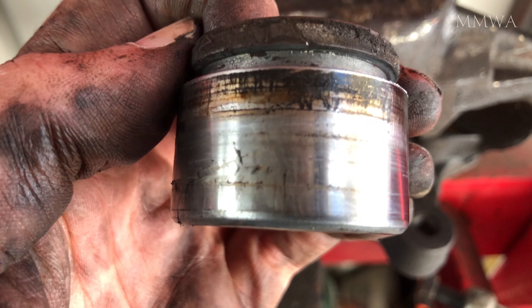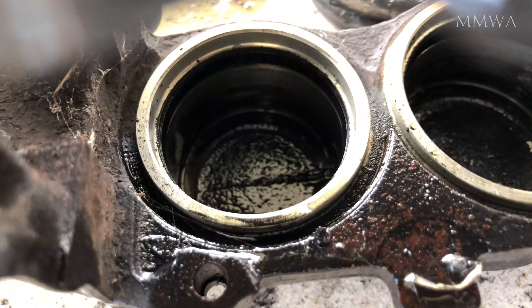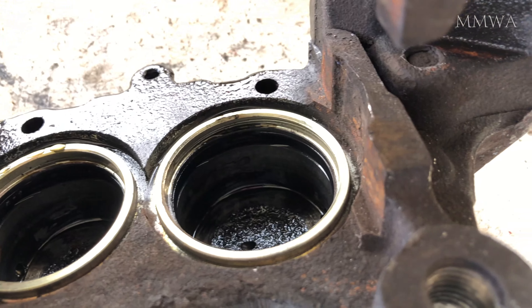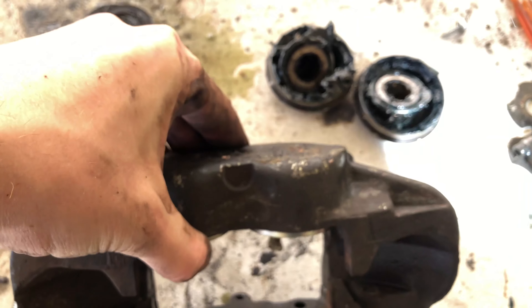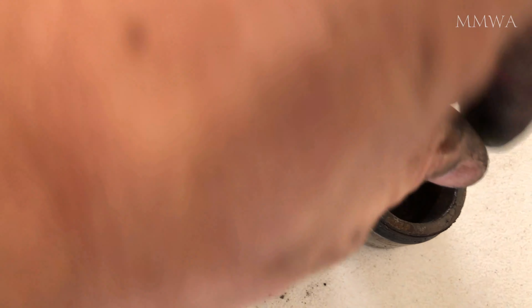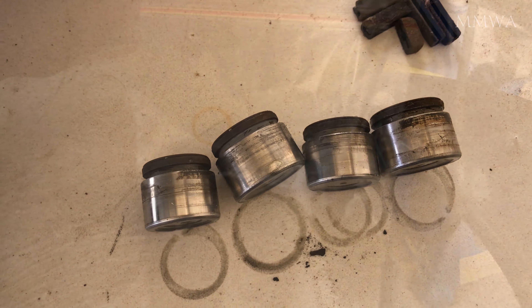This is before I cleaned up the pistons — all of this muck came off. I was really impressed with the condition of these pistons, nothing wrong with those at all. I did clean out the caliper with alcohol; this is just pretty much straight after I removed the pistons and given it a slight cleaning. I was a lot more thorough once it went inside the house. So that's all four pistons — I don't seem to have shot any video of them after cleaning, I obviously forgot. But they're all fine, there's no pitting or corrosion on the pistons themselves.